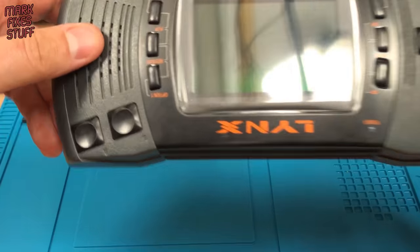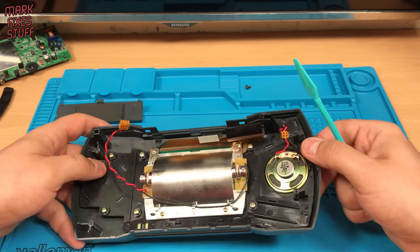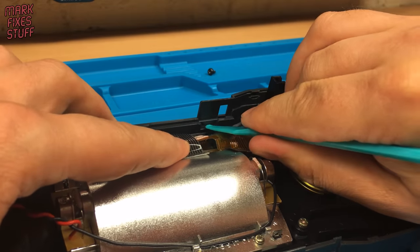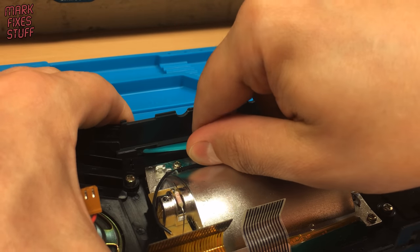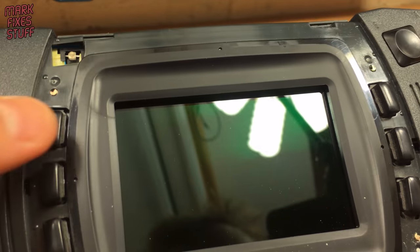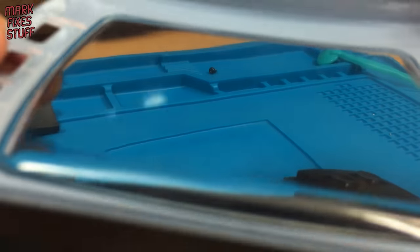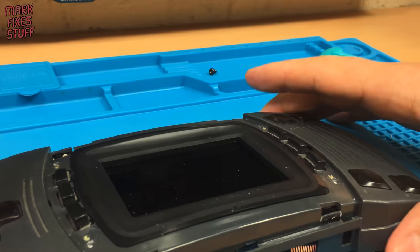With the main board free of the case we can put it to one side for the moment. As with many Lynx consoles, the passage of time has seen dust gather up inside the front of the screen, so let's give it a clean. It's spudger time again. By pushing your tool into the slot you can make the clear front lens pop off of the console. You'll need to flip it over and take care of the bottom as well. With the lens removed we can clean inside the screen cavity. The inner bezel isn't moulded on so be sure not to lose it. You can clean inside the screen even if you're not planning on changing the LCD.